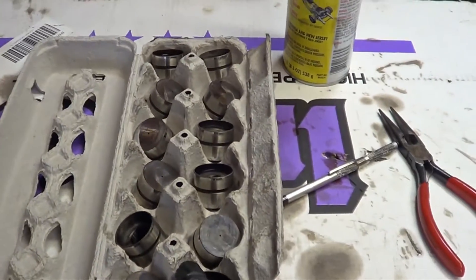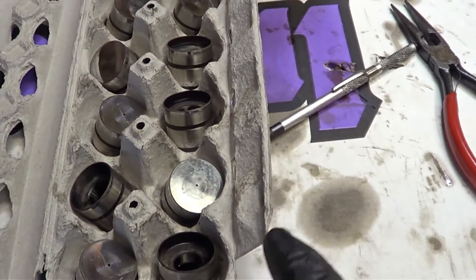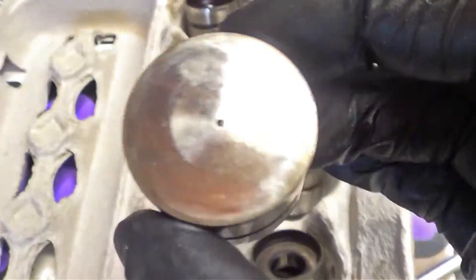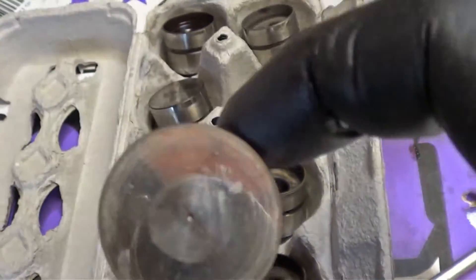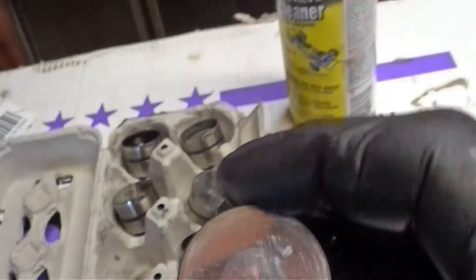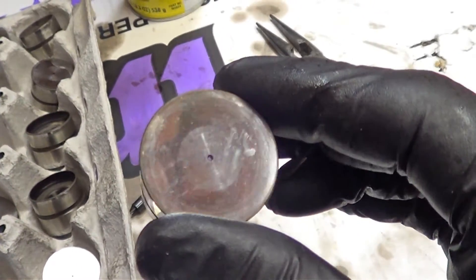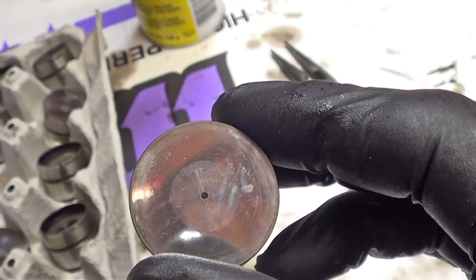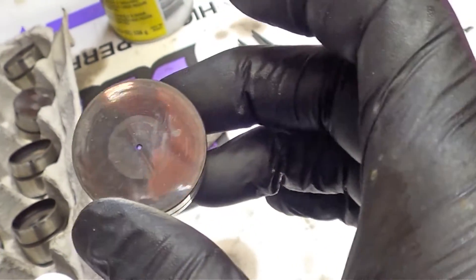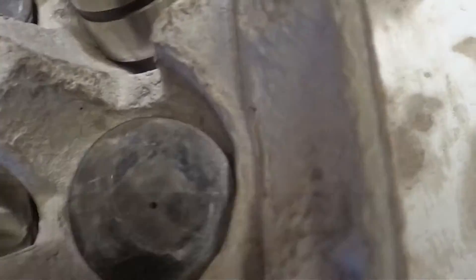Here's all our lifters — the bodies in their respective holes. They're cleaned up. Let me pull this one up — this one is suspect to me. We have strange wear patterns on the head of that. There's probably a line across here, some galling going on maybe. I'm not sure I'm going to reuse this lifter. This should probably be replaced.